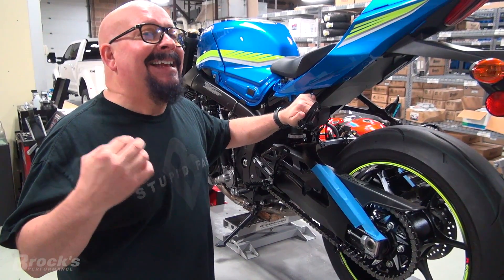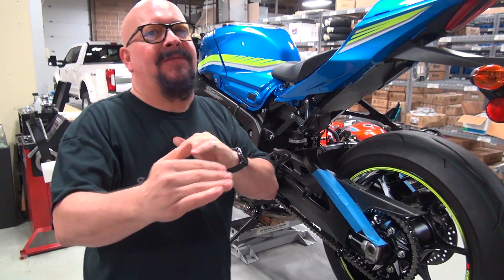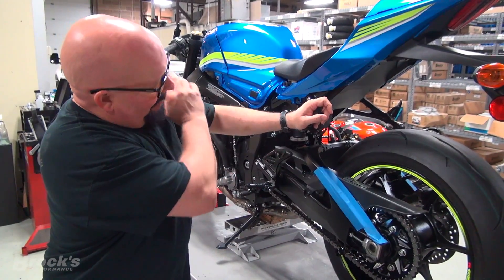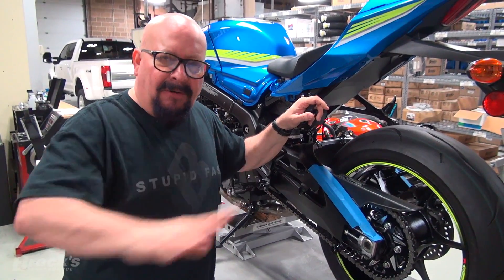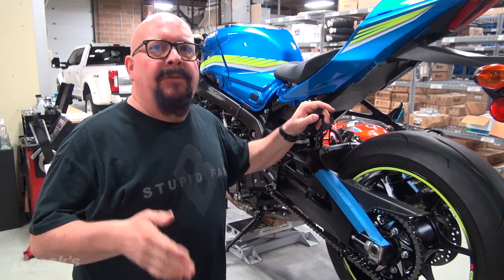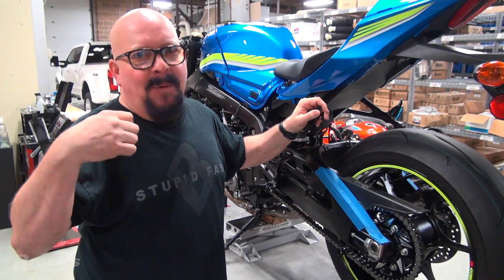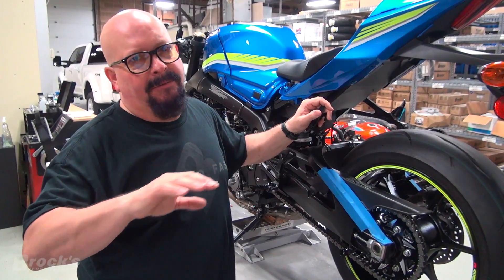What I ended up doing on my Bandit is I kept raising the bike. I was one of the few guys working on shocks at the time - everybody else had a metal rod. In theory, if your bike is on a perfectly prepared track with perfect traction, no bumps, and you can take off without any issues, your bike will be quicker at the drag strip with a strut than with a shock. The problem is we don't race in a perfect world - we don't have perfect track prep or a track without bumps.